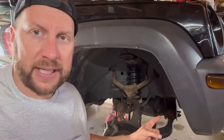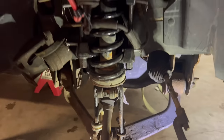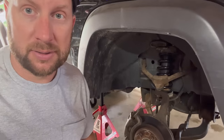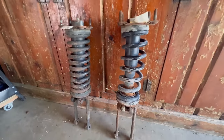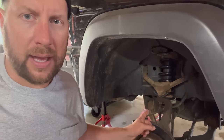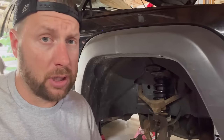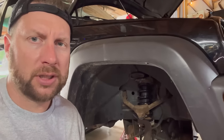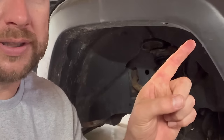That was a little insane to do. I had to use three people and a ratchet strap. We got it all buttoned up, but we had to use a ratchet strap and a lot of muscle to get that lower clevis bolt in — because adding that spacer and doing the KK strut made it very difficult to get that lower bolt into the clevis. But we got her in. I don't think we would have had that much trouble if we didn't do the KK swap. If we'd just stuck with the KJ struts, I'm pretty sure the Iron Rock lift would go right in. But we're stretching the envelope a little. So let's go do that other side.